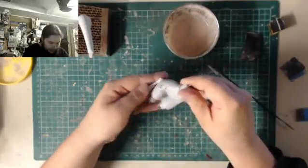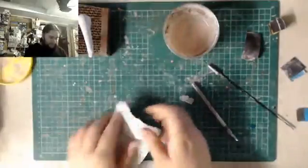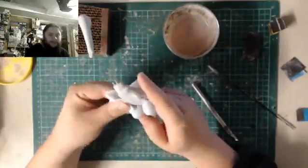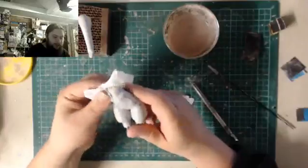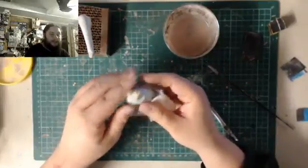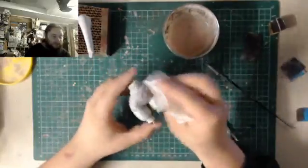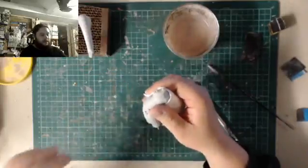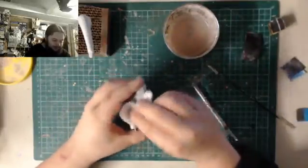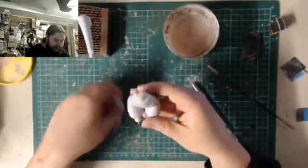But there we go. The skin and surface is beautifully smooth. The primer is lacquer based. When lacquer paint makes contact with lacquer thinner, it's activated, it becomes wet. And when you spray lacquer on lacquer, it just moistens the layer to a putty state, not a liquid state, so it's not going to mix with the top paint. Paint bonds upon paint upon paint, and it becomes the one surface, not multiple layers of surfaces glued on each other like laminated wood. More so, there's just the one solid piece. So future painting will go on nicely.